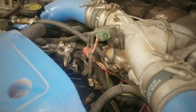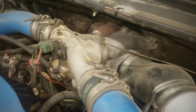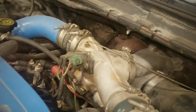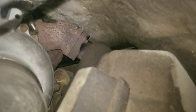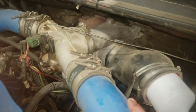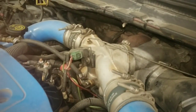I'm gonna start applying pressure and I have soapy water to spray down everything. I most likely have a boost leak somewhere and I just need to figure out where. I do have some leaky up pipes so those are gonna get fixed — I've got up pipes on order and I'll do a video on that. I want to see what else is leaking, maybe a ripped boot somewhere. I'm getting maybe 10 miles to the gallon — I pulled my boat maybe 50 miles and drank half a tank of gas.